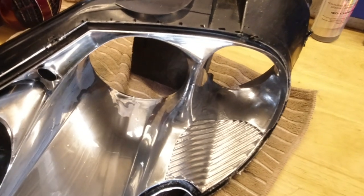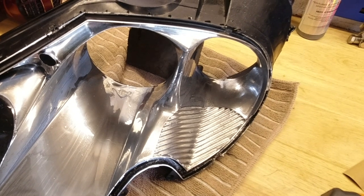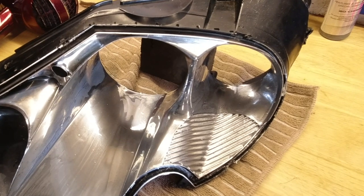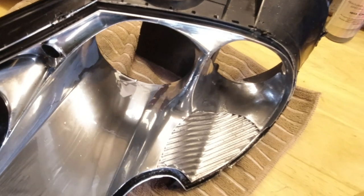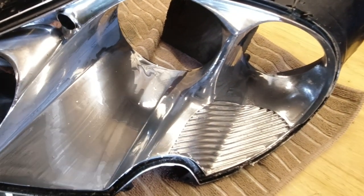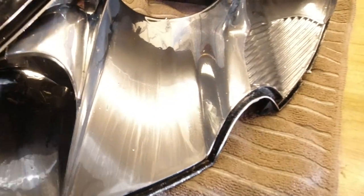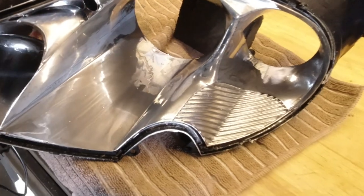Well, I think that's the end of my experiment with this. I have resilvered the headlight. It is more than acceptable. The chrome paint is capable of producing remarkable results. I mean, chrome, properly mirrored. However, a combination of my skill and the shape of this means I tend to be able to get a really good finish in places, but it's not matched in others. Now I'm going to put a lot of that down to my lack of talent, let's say, with the paint.